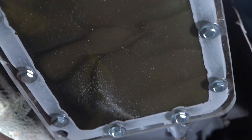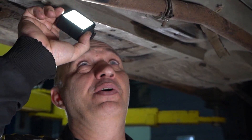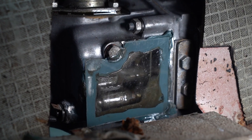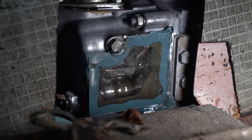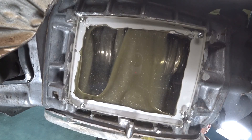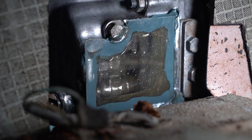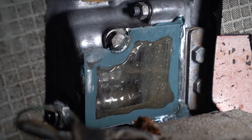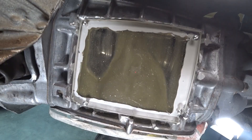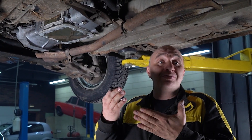Give me some gas. It's being dispersed in all directions. And what's really interesting is that if we look through the window next to the shift mechanism — you're not going to believe it — everything is lubed, you've got oil spraying around. Obviously you have rotating parts in there as well — a shaft, a sprocket. Reverse gear is not moving at the moment. Give me reverse, please. Rev it up. There we go. Looking pretty good. That is some quality lubrication happening. Obviously there's plenty of it here — everything is moving and spinning and getting lubricated. You've got an oil film that significantly reduces wear and tear.